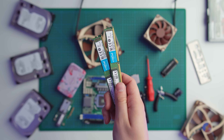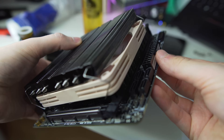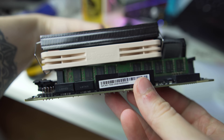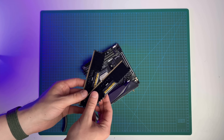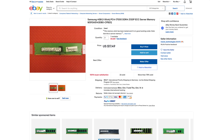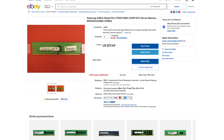RAM is where the 'I had this kicking around' thing gets a bit weird. It just so happened that I had two 16GB ECC RAM sticks literally laying around in my basement — I bought them for my desktop ITX build since they were the only sticks that would fit under the CPU cooler. Now that I have a different case, I've been trying to sell them with no luck, which is good because now I can use them in this server. If I didn't have 32GB of ECC memory laying around, I'd probably buy something like 8GB — that's more than enough for a server like this, and 30–40€ is a pretty good price.